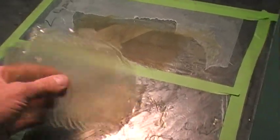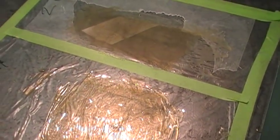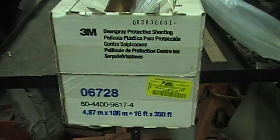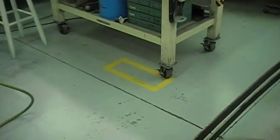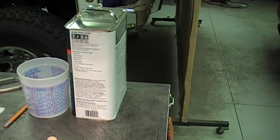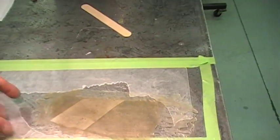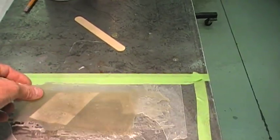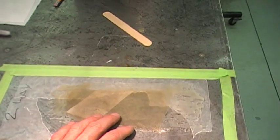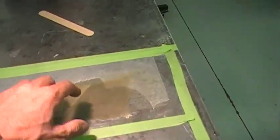This right here is a test just to see what this would actually look like when laid up. This plastic is actually a 3M car bag — the kind you put over your car when you're doing maybe a fender and you're not taking the whole thing apart. I wanted to see if the resin chemicals would burn through it. I know paint doesn't and clear doesn't, but I wanted to make sure the resin didn't burn through it — and it doesn't, it works really well. This was just another test to see how wax paper would react. We use wax paper at work with the resin we use there, which is called Epicast — it's a lot thinner. This stuff here by Bondo is not nearly as runny as the stuff we use at work.